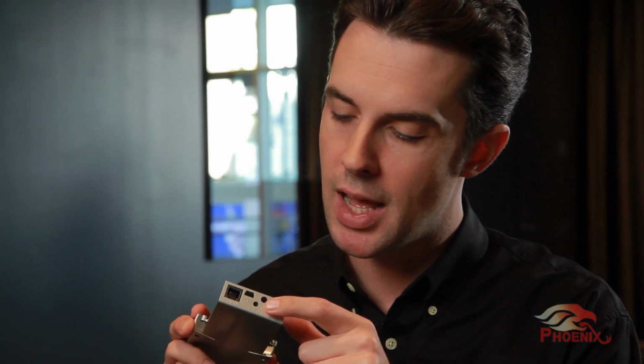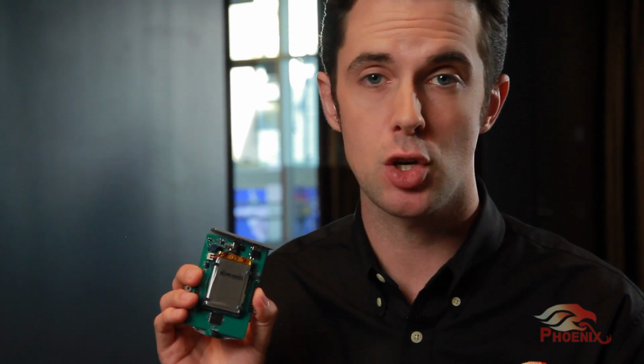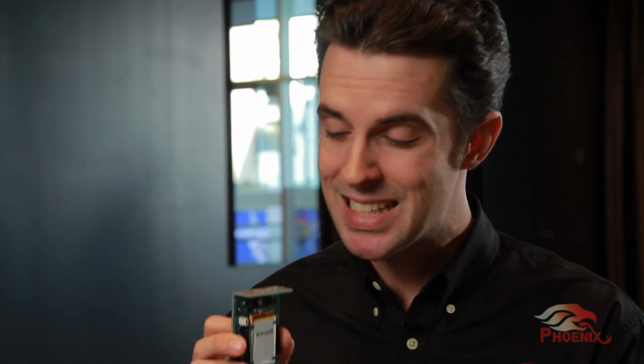The interface has a standard telephone jack and a DC jack to support the powered chain scheme, which we will discuss in another video. The unit and the interface are supplied with the telephone cable required to connect the Quattro to the telephone line. This second interface has a 2.5mm headset jack and a special cable that will connect your Quattro to any smartphone or tablet. You can also use a cable splitter and connect your Quattro to a video codec's analog I/O. This interface also comes with a built-in rechargeable battery. A Quattro installed with this interface is referred to as an MT303, while the interface card by itself is referred to as the MT323. In addition to the headset jack, the interface has a DC jack to support the power chain scheme.